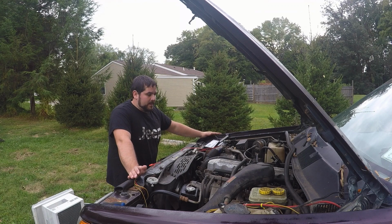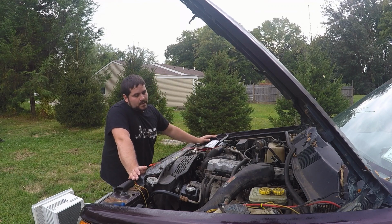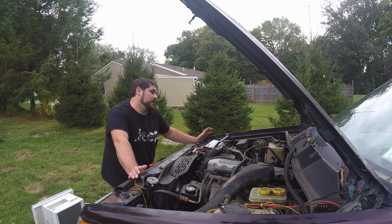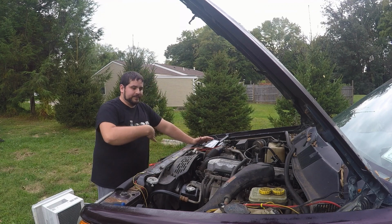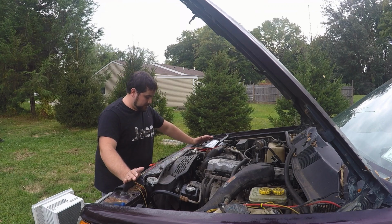Today's episode we're going to talk about cooling upgrades. The reason why we're talking about that is because in the last episode I showed you that I did the head gasket when I first got the Jeep, and that didn't solve all my overheating issues. So I decided there must have been something else wrong with the system. I also mentioned that I replaced the thermostat, and that was fine. So I started troubleshooting more.